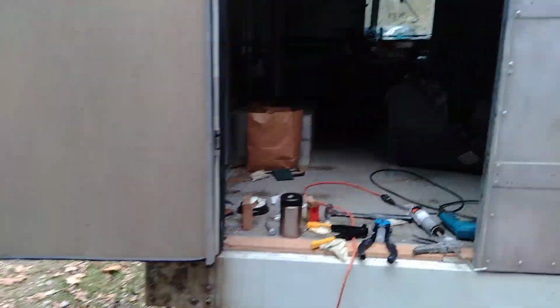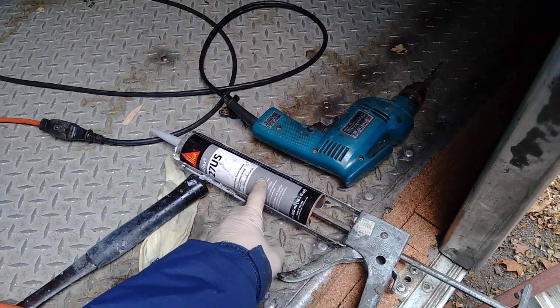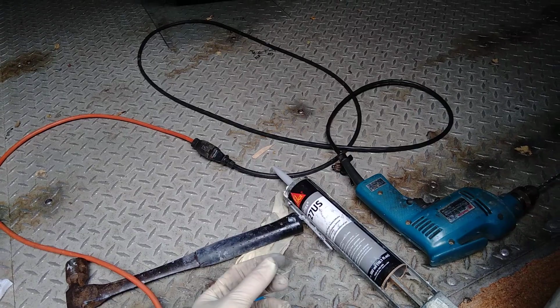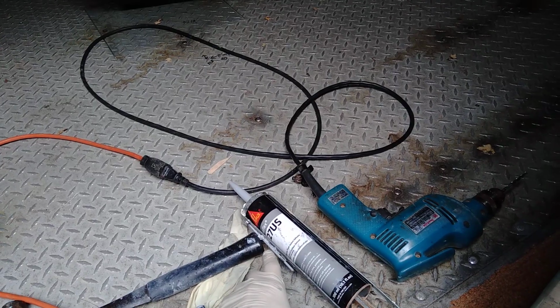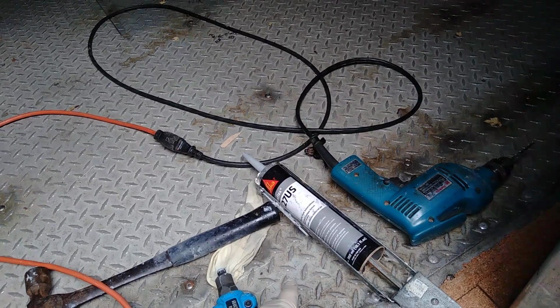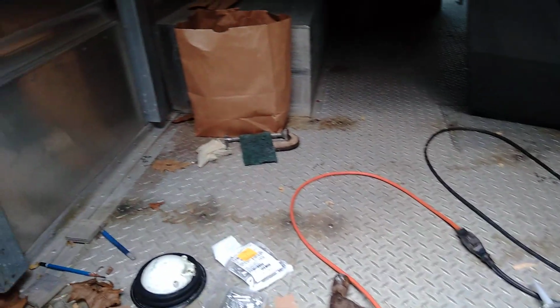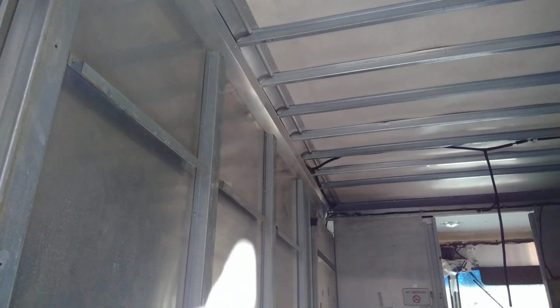But yeah, I'm pretty stoked about it. You can use a sealant too. That's what I've been doing. If I showed you on the roof, they look kind of messy around the rivet, that's because I would dip the rivet in a little bit of sealant, this stuff, Sikaflex 227. That's to cover any imperfections in the hole. You want to get the hole as perfect as possible, but sometimes they're not perfect, especially when you drill them out. I had to drill all those holes out up there.